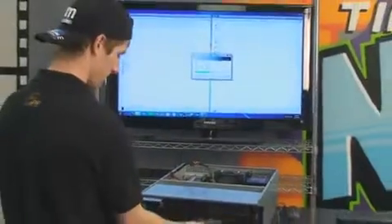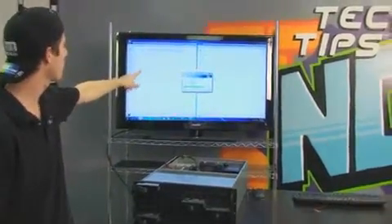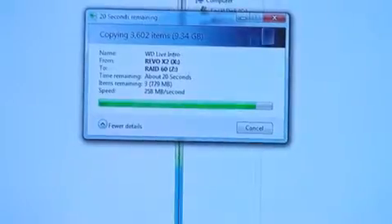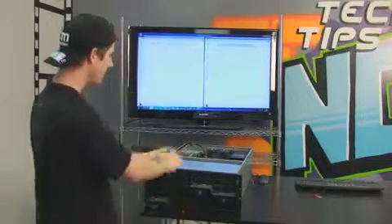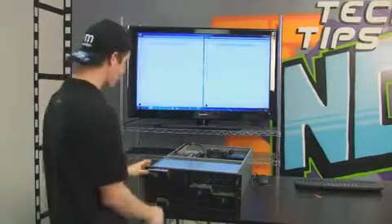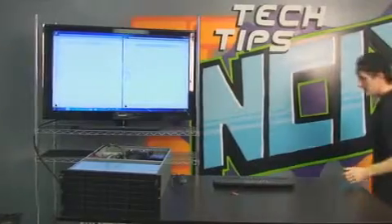I'm coming around to the front of my RAID box and I'm just going to pull out drives — I'll pull out that one and that one. This is not a trick, folks. You can see the performance went down a little bit when I pulled out the drives, but the files are still copying. I don't need these drives to be functional in order for the RAID to work. Now if they were actually dead, I would want to replace them and rebuild my array as soon as possible. But that is a pretty cool thing about RAID 60 — this array is entirely functional. It is a 20-terabyte array, by the way, using these 24 drives. I'm going to pop those guys back in, and it will have to rebuild now. But we have no time for that, so I'm going to be reconfiguring it to a RAID 0.